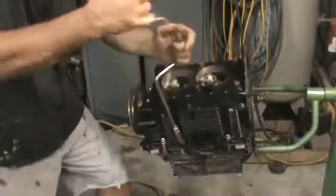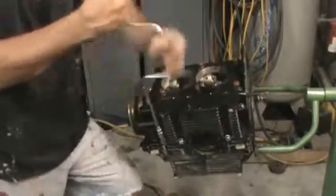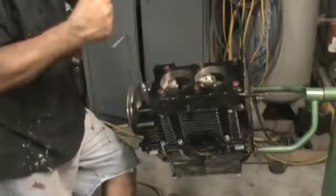and he's good to go. We got to do a little machine work on the cylinder heads, and I'm going to put the seats in there. I'm going to put new guides in. So we'll be doing that kind of stuff.